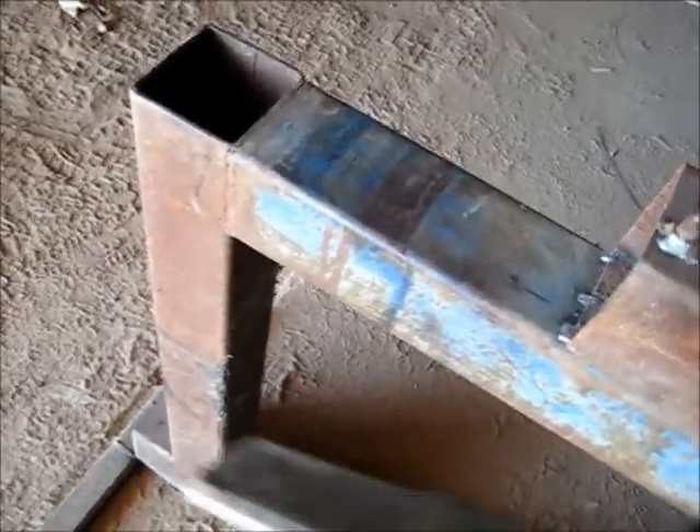Me and the old man made this. We've done something like this — that's a blade, similar to what a tyre fitting machine would use. It's just a flat piece of steel plate; we ground it like a knife blade out of it, then ran over it with a linishing sanding disc, and polished it as smooth as we could possibly get it.